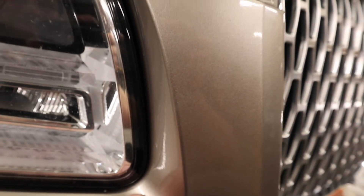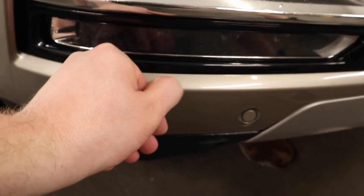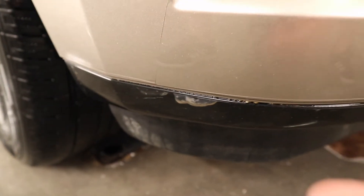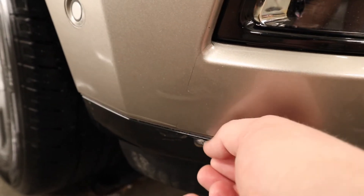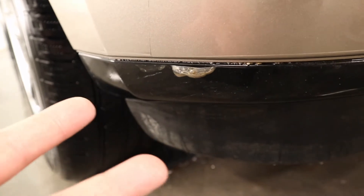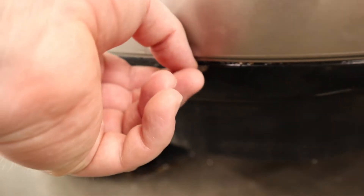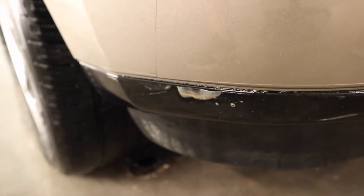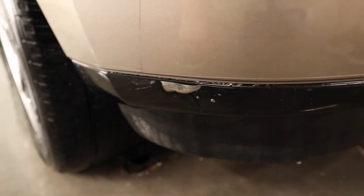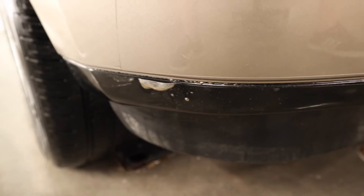Down here there's some damage as well — this one looks like it might have damaged a bit of the bumper, but we'll see once I pull the film off. The bottom plastic pieces have been installed, and the film is peeling back a little bit. The install looks like it has good coverage, but two things could have happened: the customer could have gotten too close with a pressure washer — I've seen that before — or the installer didn't properly post-heat this area. Even if you do properly post-heat, getting too close to a 2,000-3,000 PSI pressure washer can still lift up the film.